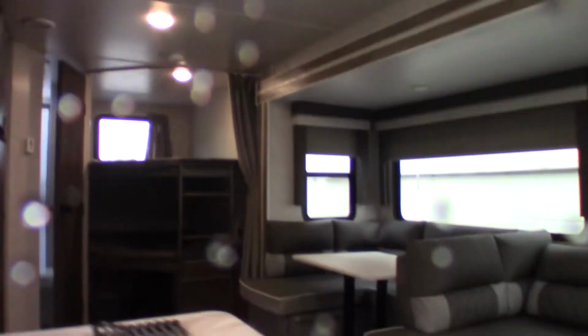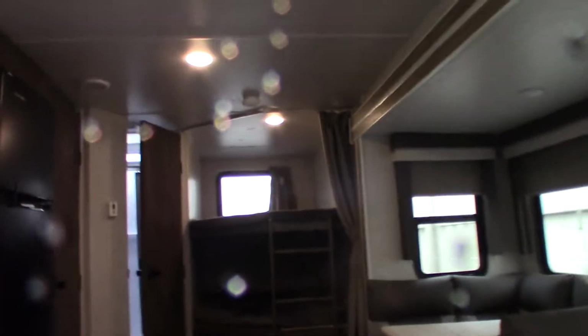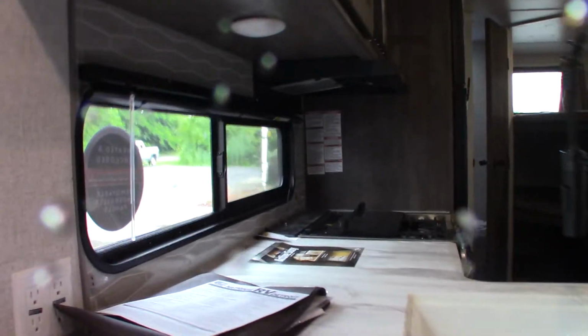Okay, so you want to go up there and look at the sealant, make sure there's no cracking or separation. You want to check the vent covers to make sure they're not cracked by being hit by a low branch, or that no road debris flipped up there and damaged the roofing material, that sort of thing. So give it a good inspection every 90 days.